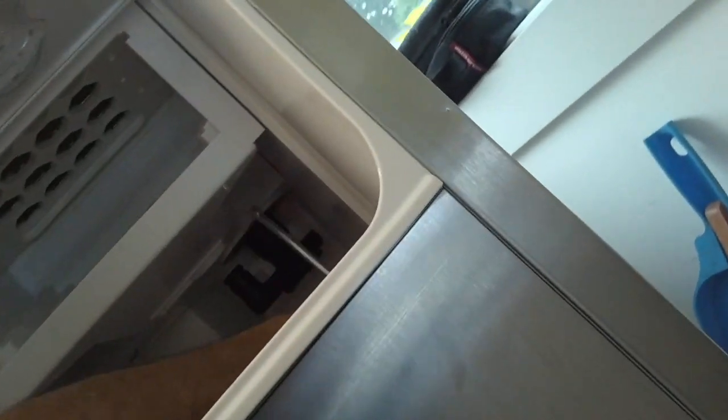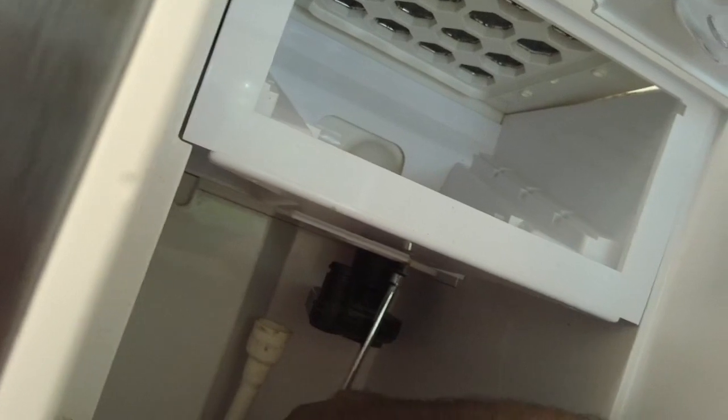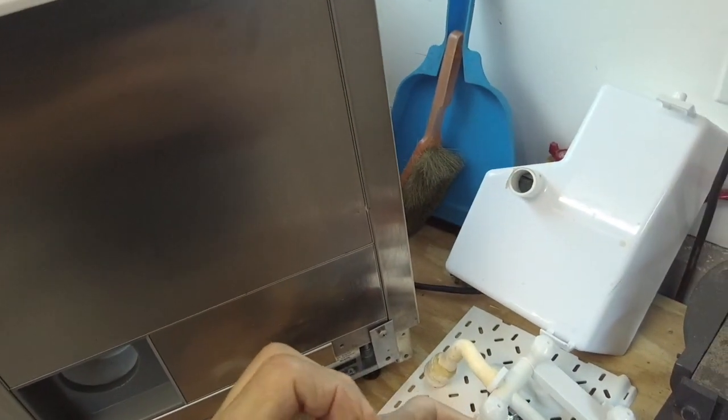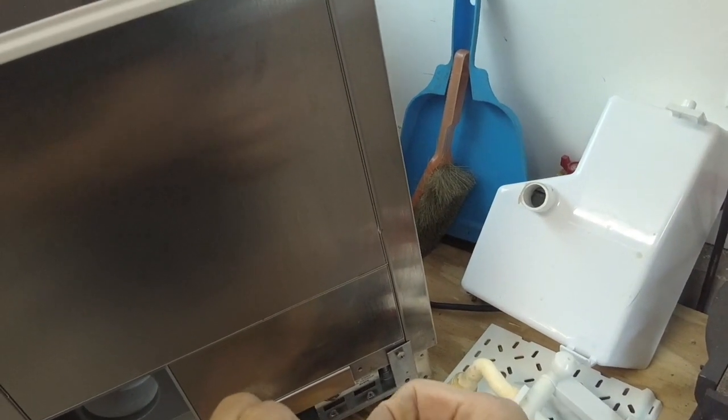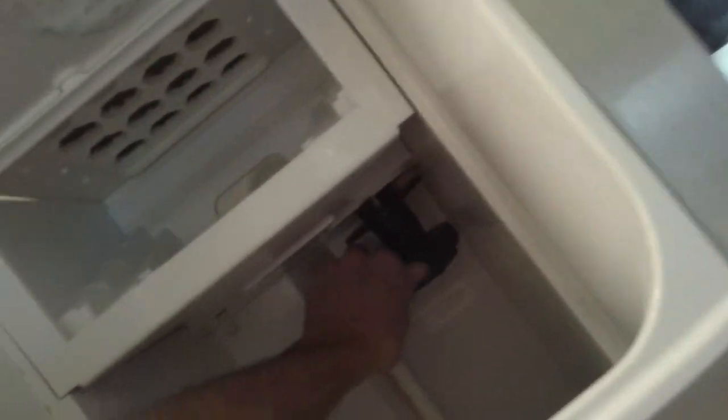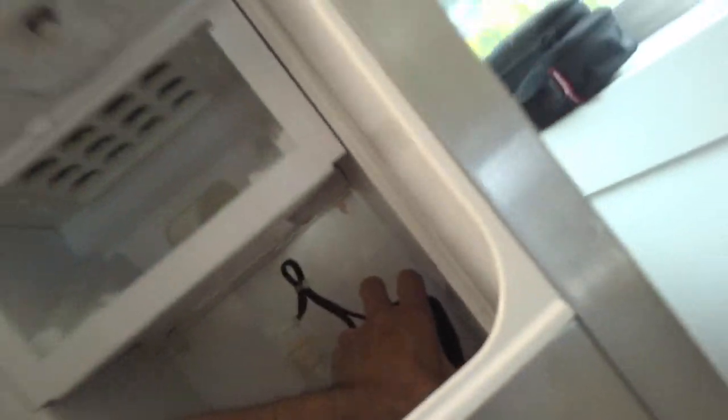And you loosen this bolt. It holds the pump up. Okay. You can see right here, see that offset? So when you tighten that up, this part of the washer is actually what holds that pump up. So we just drop the pump down like this, and you pull the pump in from here, and this is how you change the pump.